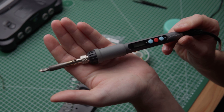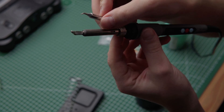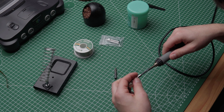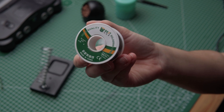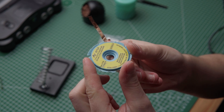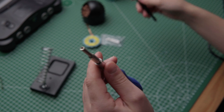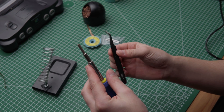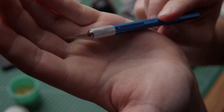Let's go over all the things we need for the install. First and foremost, a soldering iron — a cheap one like this should do fine. However, please note that this is really fine pitch soldering, so a fine tip is recommended. We also need some solder, soldering wick, a little bit of flux, and some tools like a game bit driver to get into the N64. There is also a need to cut the shell for the mini HDMI out, so I also have a sharp crafting knife ready.